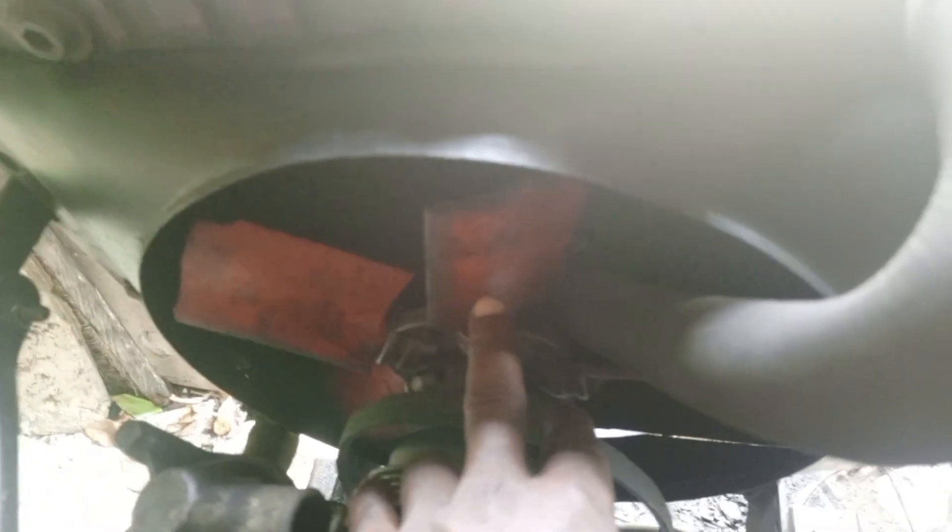The cause of the overheating is the setting of the blades. You can see this is the fan blade. You need to notice the blade has a setting. Like other engines, you must set the blade. If the blade is flat like this, it will not work. You need to tilt it a bit, and follow the arrow on it so you know which way to tilt the blade. That's the first problem — overheating. You need to wash and set the blade.